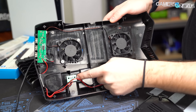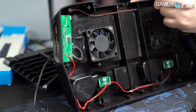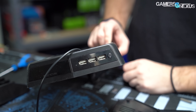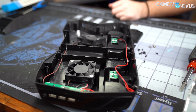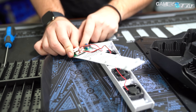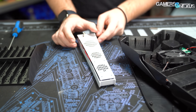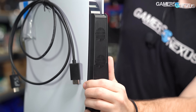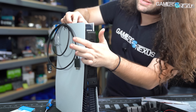The charging is done by two tiny connectors that also just use five-volt ground. There's also the front USB pass-through and switch to turn the fans on and off — which should probably be in the off position always. Here's the other unit, pre-disassembled. There's the fan on/off switch, and you can see an enormous amount of plastic that, even if the fans were pointed the right direction, creates a huge obstruction to airflow performance.